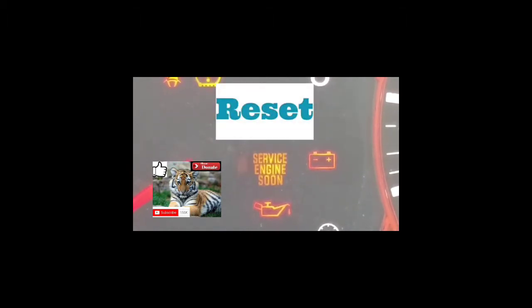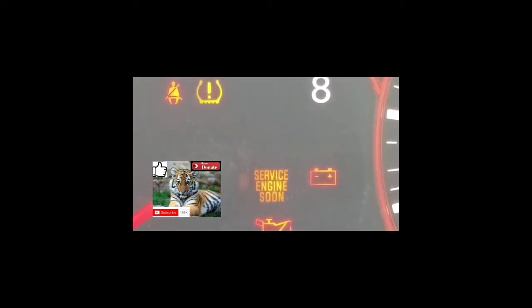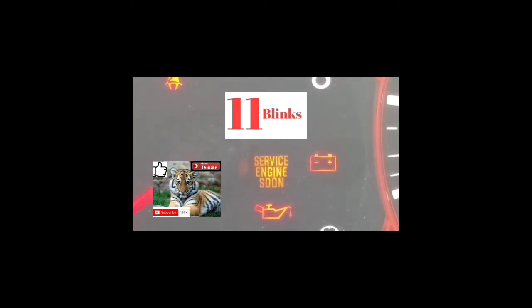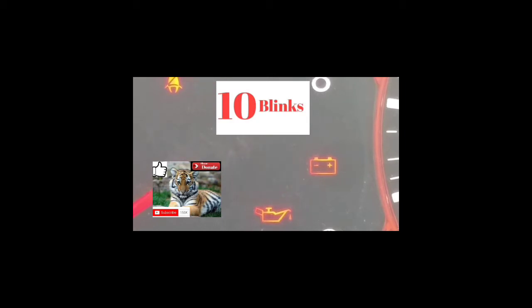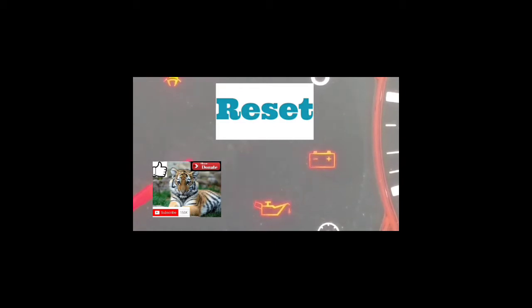You're going to have to read it from the number of blinks and the pause between the number of blinks. It's going to take a little getting used to — it took me a couple of tries to read the codes exactly. Basically the way this works is there's going to be a P on every single one of these codes. These codes start out with a P, and then the first couple of blinks are going to be the slowest. It's going to blink, then pause, and it's going to do that for four numbers or letters.